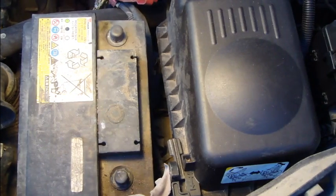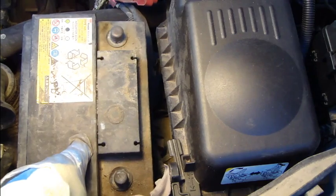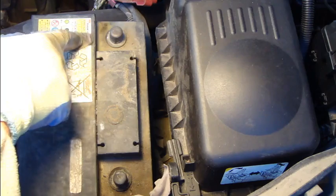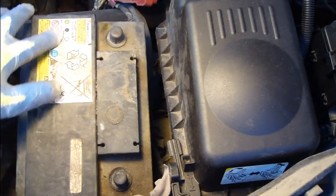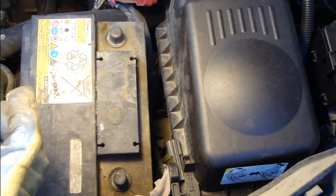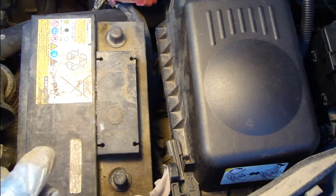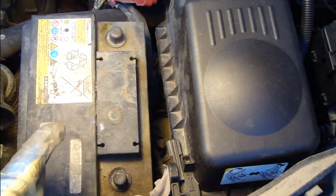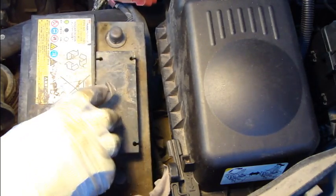and this battery weighs something like 10 to 20 kilos, and it's important that you take it with both hands in here and use gloves, like plastic protective gloves, because this battery is quite harmful, and there are warning messages. If this battery liquid inside goes to your hand or especially eyes, then immediately wash your hands and eyes with fresh water, and go very fast to a doctor, because this is the only problem in this battery change, that there is this harmful liquid inside of this plastic cover.